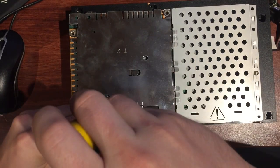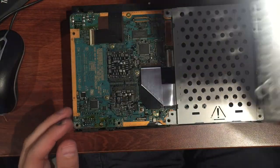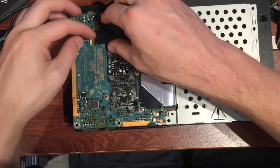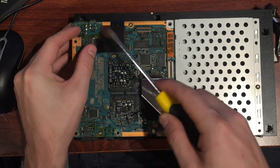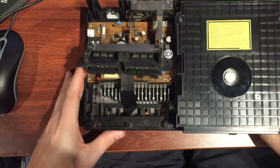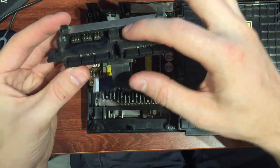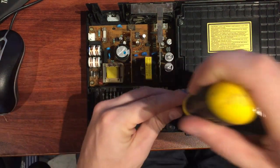We should have taken this tray out first. Do that on the back — same gold screw, take that out, that'll get washed, it's just a bit of metal. This ribbon connector: flip the little lock up like that and the ribbon will just slide straight out. Turn the whole thing back over and that will just lift out. There's a fair bit of electronics in there so I wouldn't dunk that in water, but you can get in and clean these out pretty easily.